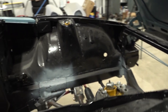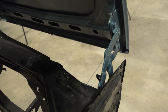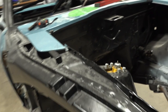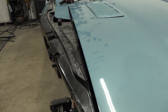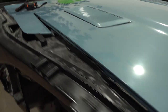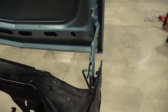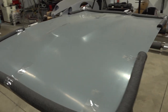On top of that, back in 2015, Dave had a bunch of his buddies over to do some rust repair, and someone went ahead and decided to put a big plate where the factory hinge mounts without ever thinking it might affect hood clearance. So you can see we have a big gap on one side and it's practically touching the rail on the other. These hinges have no adjustment in that direction, so 2020 Dave went ahead and bought a fiberglass hood, which also needs to be mounted — and that's where we'll be starting.